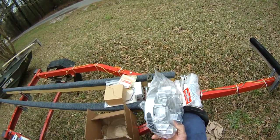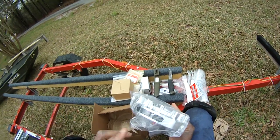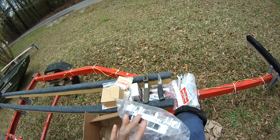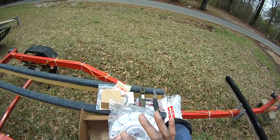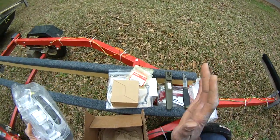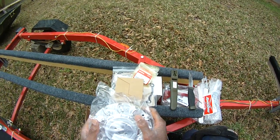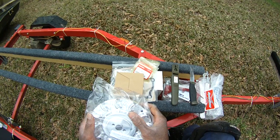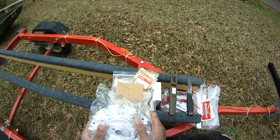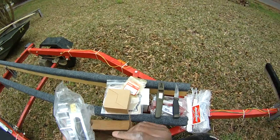If you start running at 6,000 RPM like I'm running here, this magnet, because this is a magneto, electromagnetism, will delaminate and come out, and it can kill you. That's why you go with a billeted flywheel, which gives you safe power at higher RPM. Now look, I have to put a disclaimer on this: don't be stupid. Hopping up motors is dangerous, and you do this at your own peril. I'm showing you the best practices as known. If you are going to remove the governor on your motor, you have to use a billeted flywheel. Period. Because that magnet will delaminate, spin off and kill you.